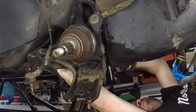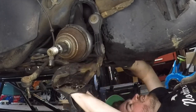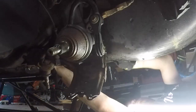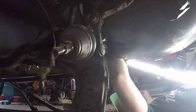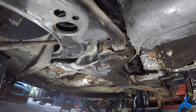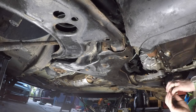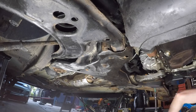Now I'm working on a few pieces not directly related to this lift, but I am going to be removing the control arms. The control arm bushings were bad and needed to be replaced, so I'm pulling out the two bolts that hold those in place. However, in my case the oil pan for the transmission and the oil pan for the engine were both in the way, so I had to lower that subframe a little bit without pulling it all the way out so those bolts would slide out.